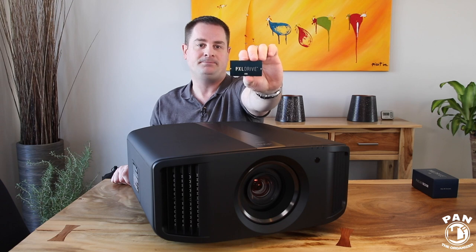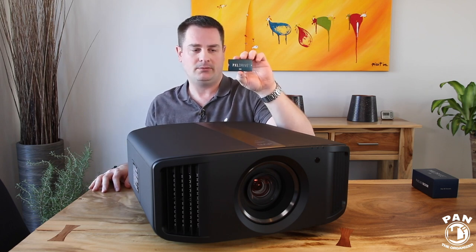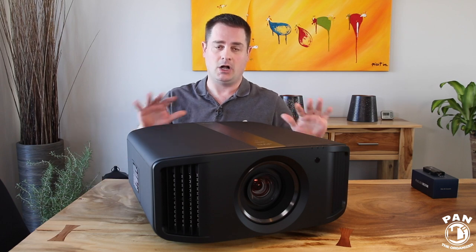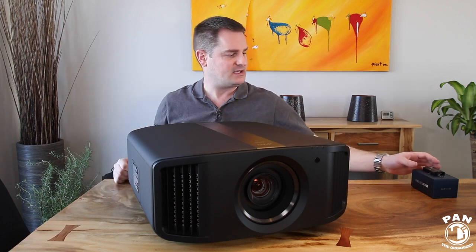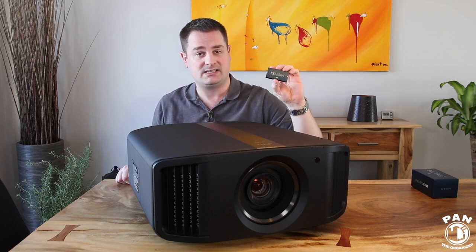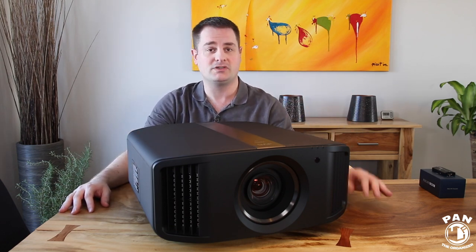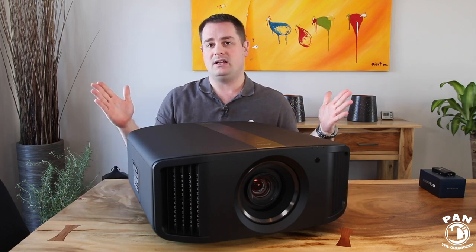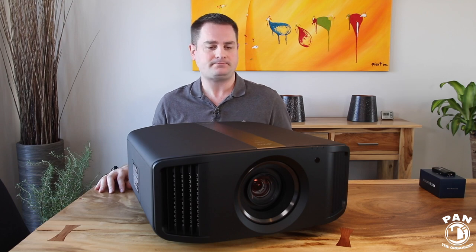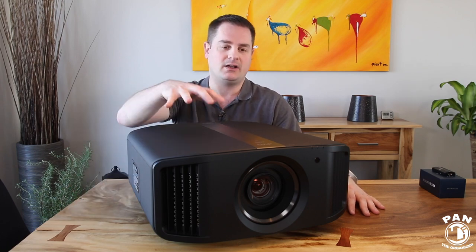They also have a unit called the Excel that you can supply power to through a micro USB cable. I'll make sure to include the links to all the products I talked about today in the description under the video. The PixelDrive from PixelGen — thank you for inventing this product, because it's a life saver. It allows you to avoid going through your ceiling and walls again just to run a new HDMI cable capable of those 4K throughput speeds. If you have cable lengths that are very short — one to two meters — your standard HD cables from a couple of years ago should still do the trick. But in my case it's a fairly long run at 10 meters or 32.8 feet, so I needed to boost that signal to make sure I got the full capacity.